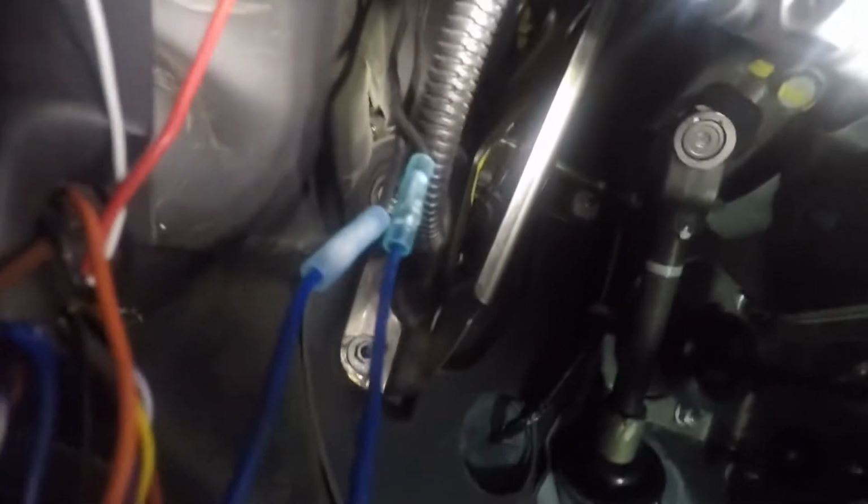Don't worry, we're going to get more into this. I know it looks like a lot of wires, but these two are the fatter ones, and they're coming straight from, I believe, the starter. The only two wires going through, I know they're blue right here, but they're black right there. There's little crimps, and they crimped on those two blacks coming from the firewall to these two wires right here. So basically, you're just going to splice these two wires together, and that bypasses it so that you don't have to blow into it to start the car.